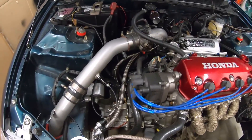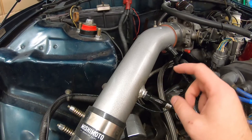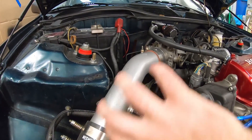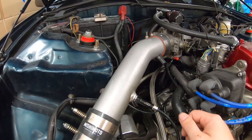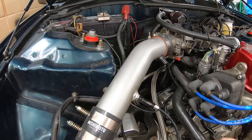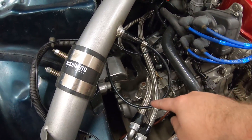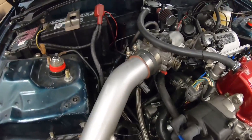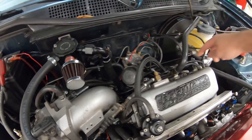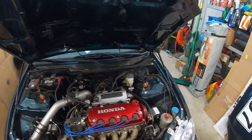The main component of the kit is obviously the injector itself. Here you can see mine — it's tapped in; they give you a weld-in bung that's tapped into my intake tube, and it's actually spraying this way. The reason you want to do that is because it gets sucked back in and helps it atomize — very similar concept to guys running nitrous. They spray away from the intake manifold because it helps atomize the combustible and gets you a better mix. This is the feed line coming from the trunk. Up here there is also a T and a boost reference source running back to the trunk.